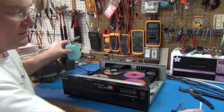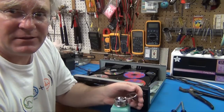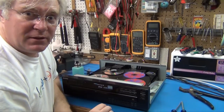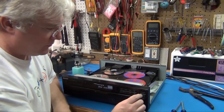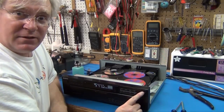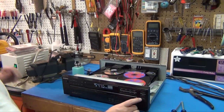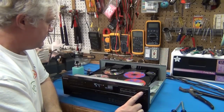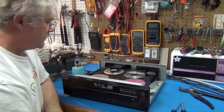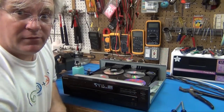I took some of my 99% isopropyl alcohol and some Q-tips and cleaned up the optics. It was just acting like the optics weren't seeing when things were in the right place. Everything seems to be fine now. I'm going to go ahead and just play a little bit of music — and this should be about it for this rebuild fix. I'll just cycle through the discs and see it work.